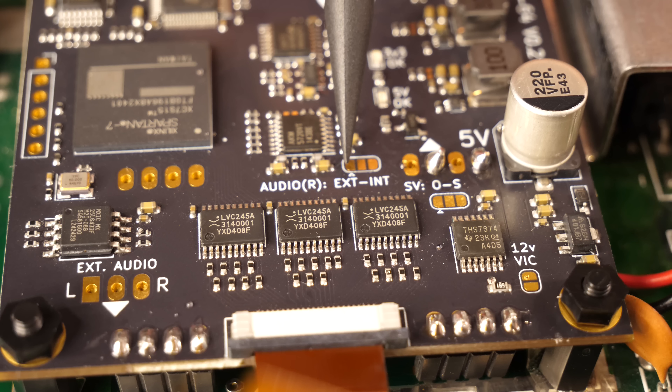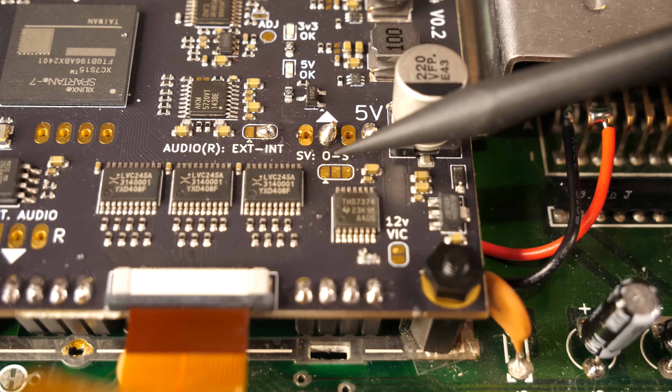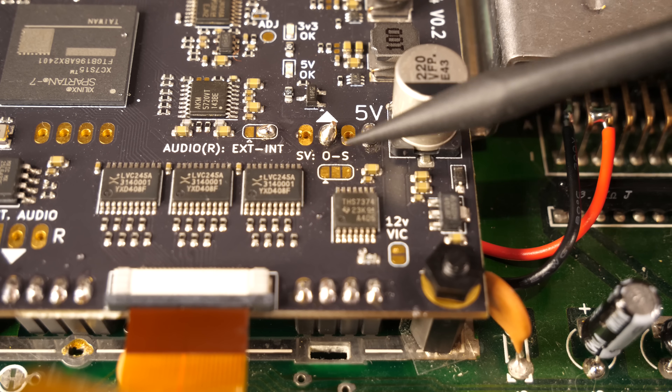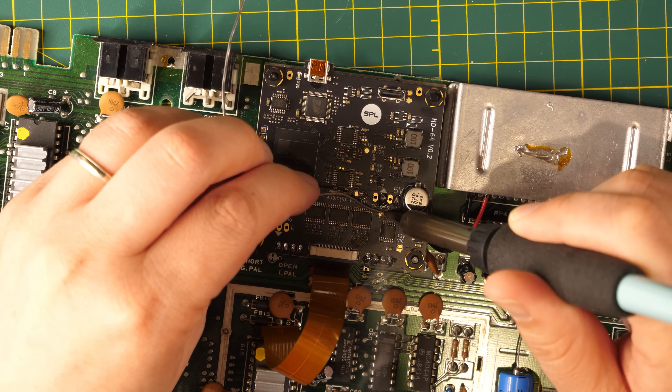Before using an HDMI monitor, I had to set some jumpers for configuration. There's a jumper for the audio channel, sending the right channel to an external device or internally through the HDMI port — for now I chose the HDMI port, as I haven't modded this C64 for stereo sound yet. There's also a jumper for setting the S-Video output to match the original C64 spec or the modern S-Video standard, and I chose the latter since I don't plan on using this 64 with an original Commodore monitor anymore.